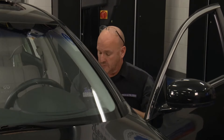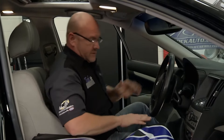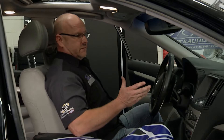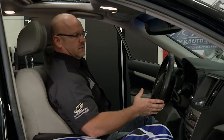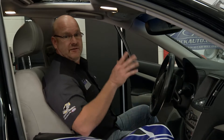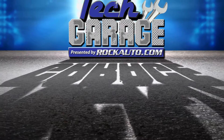That's the final of all four mounting bolts. We've got the framework back with the vehicle, so we can test drive the seat motors. If there was any play, we could damage those seat motors or actuators. If you remember, for John it was moving right but not left and there was a twist. Going fore and aft - no sounds, feels very fluid, it's parallel, both tracks are working right. We fixed that motor. Testing everything else: forward, back - smooth. Hip hugger, lower lumbar - all great. We spent a little time on this project but saved a ton of money. Ended up being a $4.50 part from rockauto.com. Absolutely worth it.